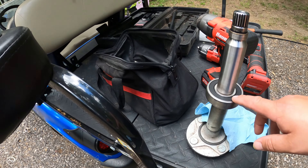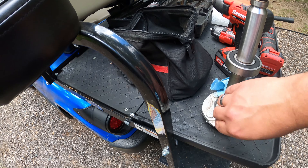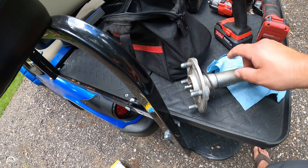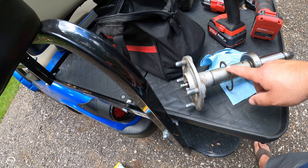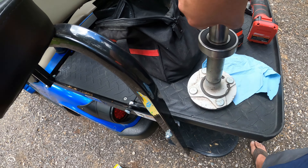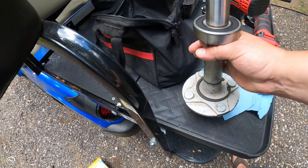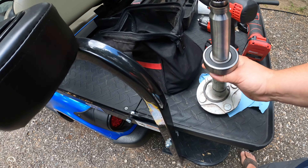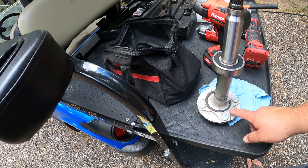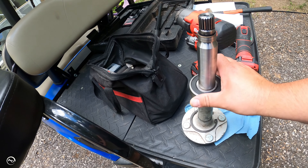It is a week later. I did not have the opportunity to record this part, but it's super simple. All you have to do is hammer the hub off — this piece slides off after it — then remove your snap ring and your bearing will press off this way, then press on the new one. This is what it looks like with the new bearing on. I just lightly put the hub on because when we tighten down the axle nut it'll bring it in the rest of the way.